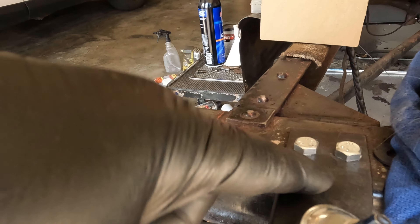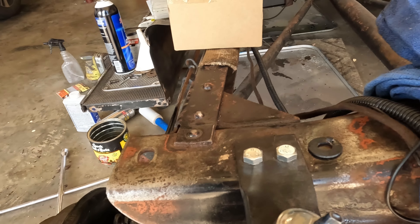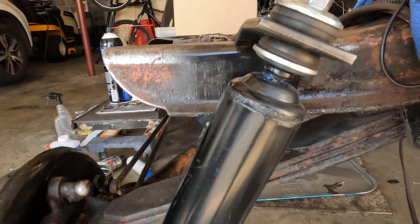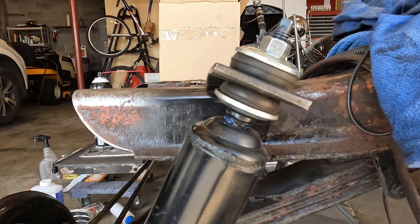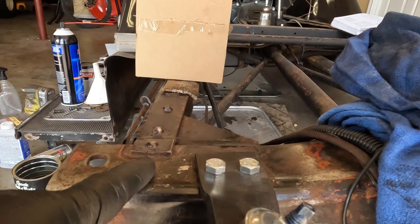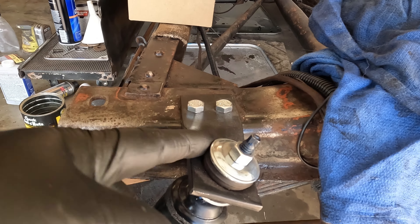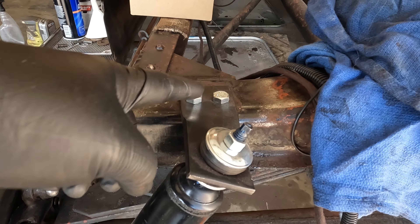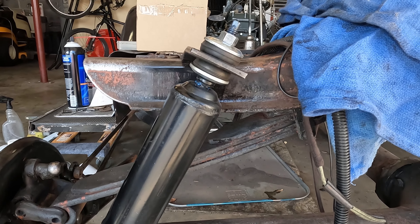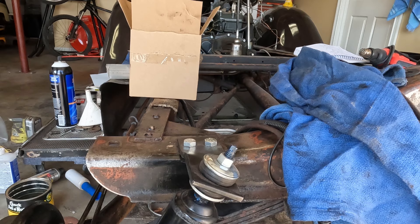One thing I want to point out is the top of the shock mounts, right where the bumper would be. You can see how much higher the top of the shock rides over the top of the frame. On a four-door, this is all wood that mounts right here, so there's a whole lot of carving out needed to get this bracket and my big paws in here. The only way I can see doing this on a four-door is either cutting a lot of wood or raising the body to get in there.